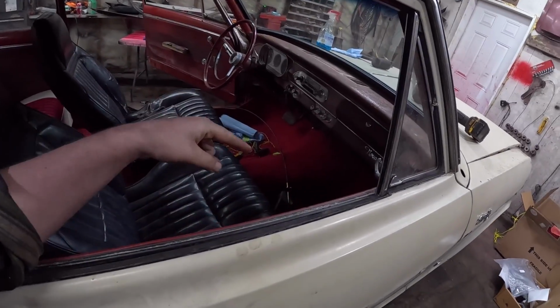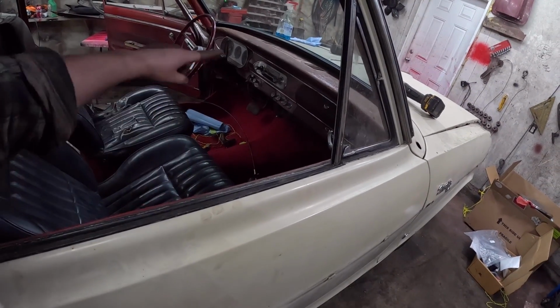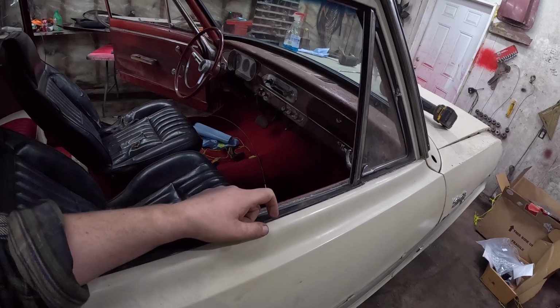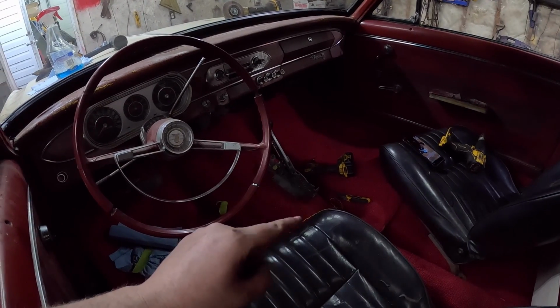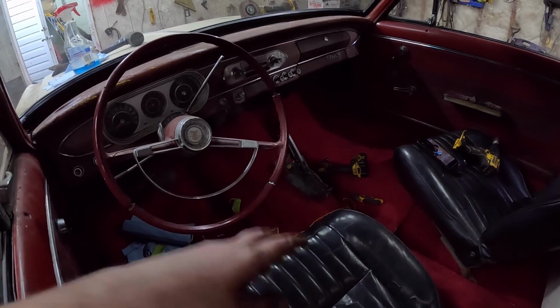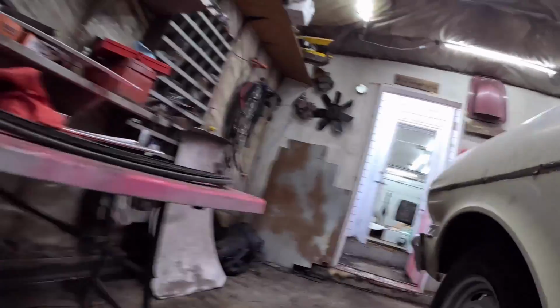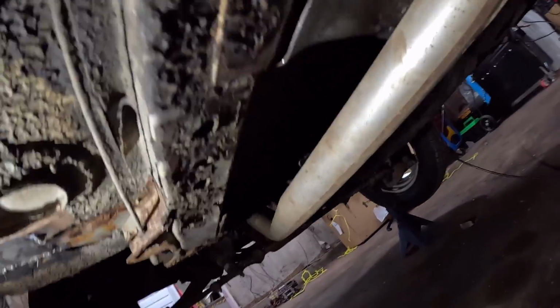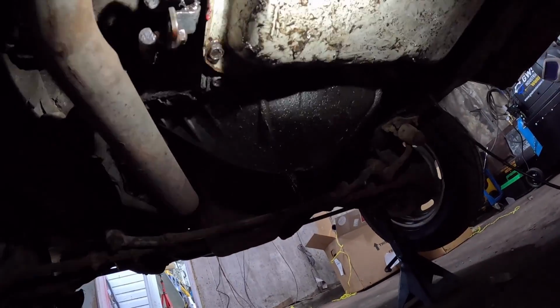I'm going to just self-tapper it to the floor, because that's all you ever have to do. One hole through, we'll wrap around, and we'll go to the transmission. Easy peasy. Shifter is mounted. I need to put a couple of spacers on the back bolts. It only has 2 holding it in, but it's fine for now. Needs a little bit of screwing around, but I want to make sure this all works. So I'll just show you here. That's the best way.